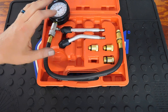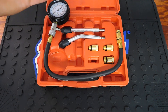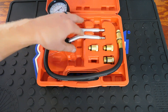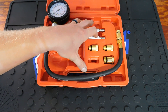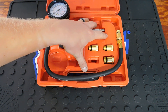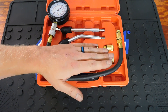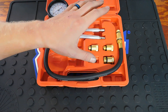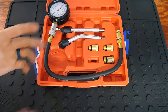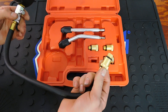It's best to disconnect your ignition system so you're not sending spark anywhere through your spark plug wires. As for fuel, you want to disable your fuel injectors — either disconnect the injector itself, or on most modern vehicles, holding down the gas pedal puts it into a clear flood mode that disables the injectors. You don't want to flood your engine by squirting fuel in without starting the car.